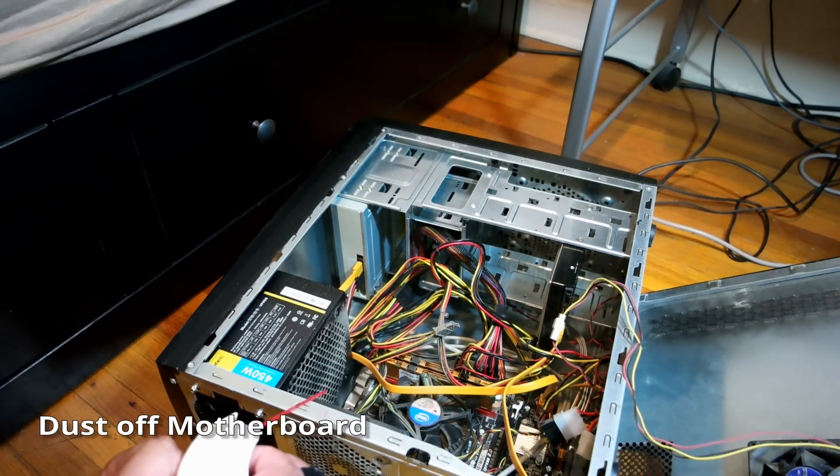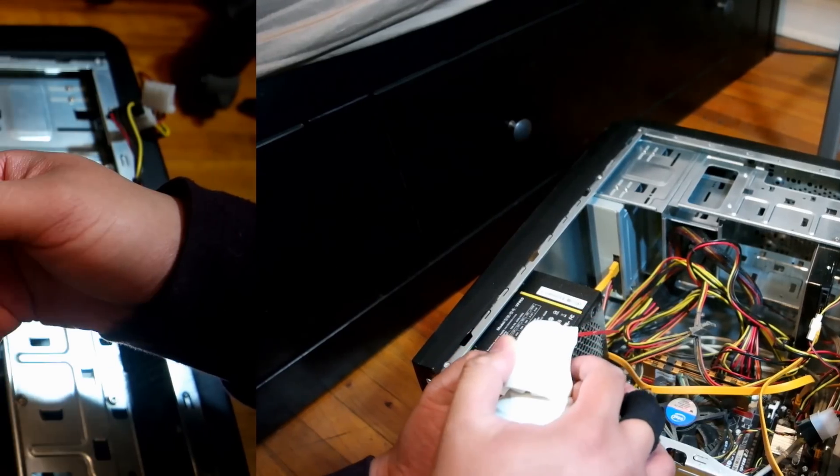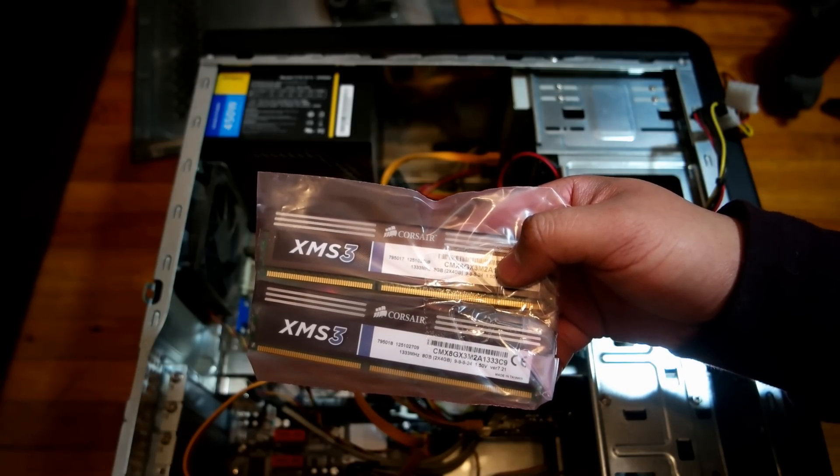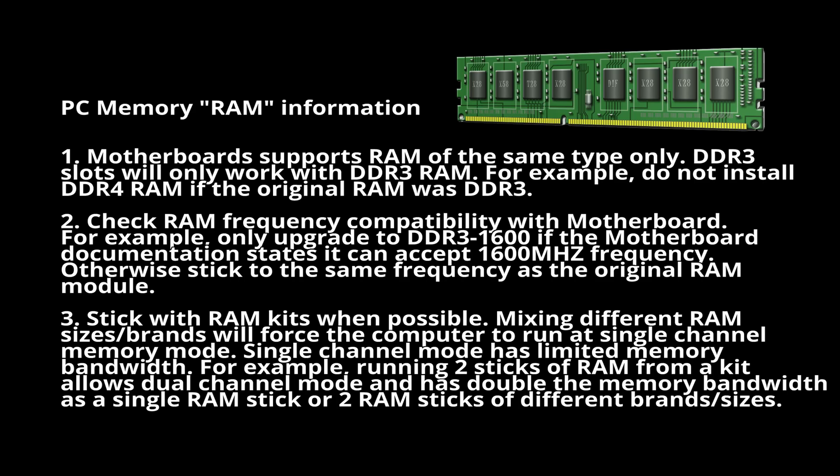I'm going to upgrade the RAM first since it's the easier one to do. This is an 8GB RAM kit — each stick of RAM carries 4GB. This motherboard has 2 RAM slots, so naturally you want to fill up those slots with RAM of the same type. When choosing RAM, you always want to occupy at least 2 slots if the motherboard is capable of running RAM in dual channel, or occupy 4 slots if the board is capable of running in quad channel mode. A single 8GB stick occupying 1 of 2 RAM slots has less bandwidth running in single channel mode as opposed to 2 4GB sticks totaling 8GB running in dual channel — the 2 4GB sticks have double the bandwidth. In short, always try to run dual or quad channel over single.